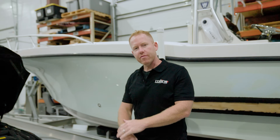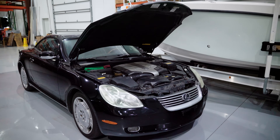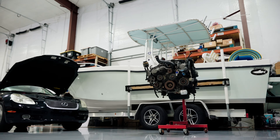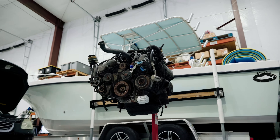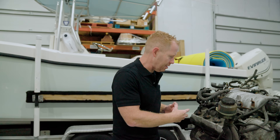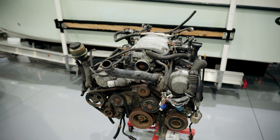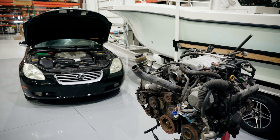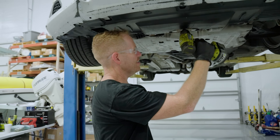The Lexus family of engines started around 1990-1991 with the onset of the LS400. The predecessor was the Toyota Cressida, and that was kind of the start of Lexus's campaign to create something truly amazing. They have a 32-valve four-liter, six bolt mains — everything worked to the nines. They spent over a hundred million dollars in R&D back in the 90s to develop the UZ family. This is the latest iteration: a 4.3-liter, six bolt main, 32-valve, four-cam, independent coil-on-plug, sequentially injected V8 — 300 horsepower, 300 foot-pounds of torque. It will never break as long as you keep 93 octane and good oil in it.